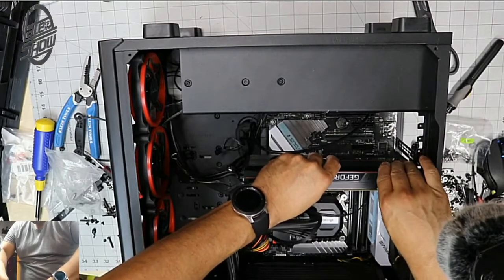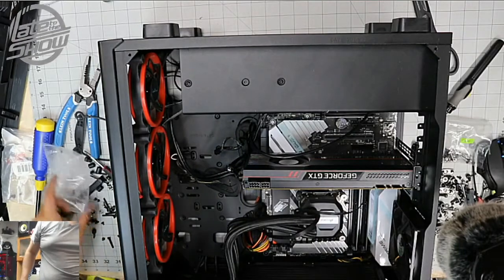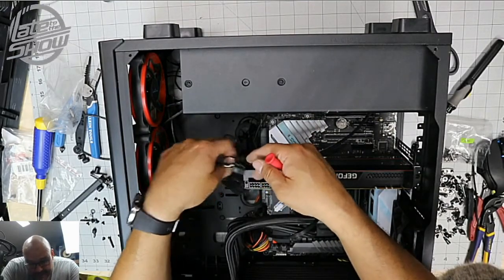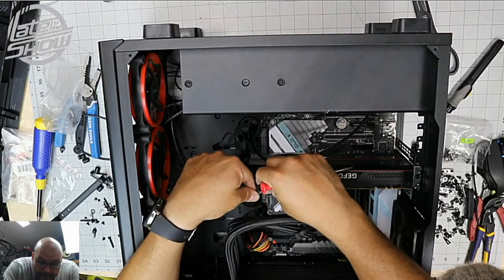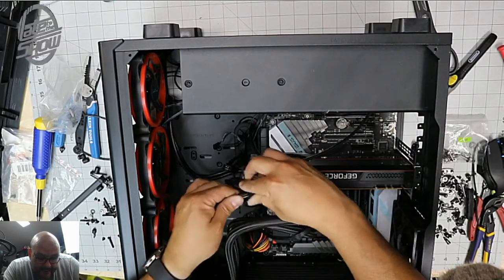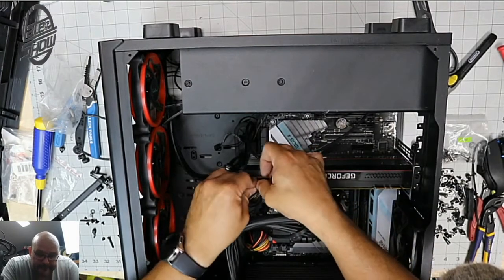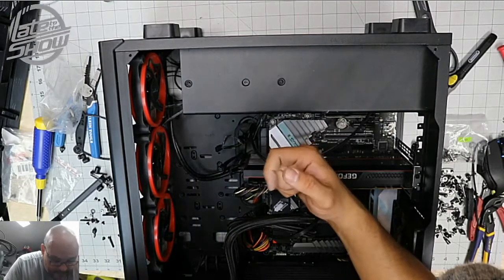I like that they have those metal brackets now. We're gonna secure the video card with a screw because we don't want to damage it. Now we need to power it up — we have four connectors on one side and two on the other. Four will go here, embedded in this direction. Then we got the six — six units here. You gotta make sure you line them up properly because they're a little bit off. I don't want to force it — just hold it from the bottom and squeeze it tight. We're set to go.